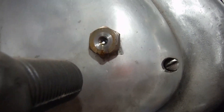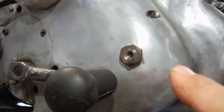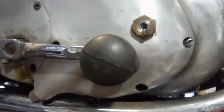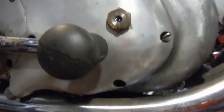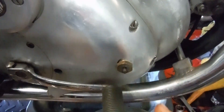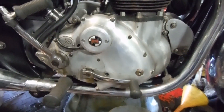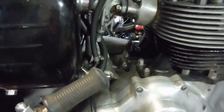As you can see, there's oil dripping out every so often from the check bolt opening. What I'm hoping to see is that now I've got this open and oil dripping from here, perhaps in a little while it'll stop dripping from the crankcase — because I want to try and prove to myself that the oil coming out here is what's been going through into the crankcase and collecting in the bottom. If it is, that will confirm it's getting past the oil pump. But if the dripping from the crankcase drain area continues, that might also suggest a gasket fault between the oil pump and the engine crankcase.